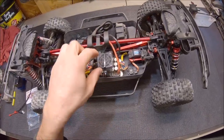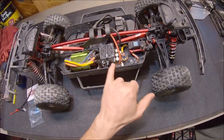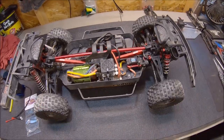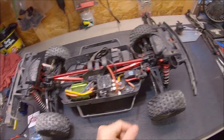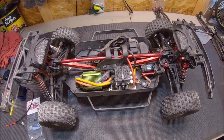As for the one I put on the ESC, the fan went out so I took it off the heat sink and ran two stainless bolts down into the top of the heat sink at the ESC, then ran a zip tie on it so it's not going anywhere. I don't really jump this truck for big airs so I don't see an issue with it sitting up there. It's definitely going to keep the ESC cool — it's got some major airflow to it.